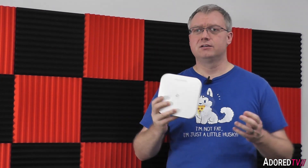In summary, this is a great little device delivering Wi-Fi 6 in a very small package. As a business-class access point, it provides access to the on-premise network but is not a router and won't replace a prosumer or consumer router. It provides high speeds, especially close to the device, though signal does fall off rather quickly around the 30-foot mark through walls. Other devices with bigger antennas might achieve faster speeds at distance but will be more bulky. With its ceiling-mount clips, this access point sits very low-profile and unnoticeable to employees or customers.